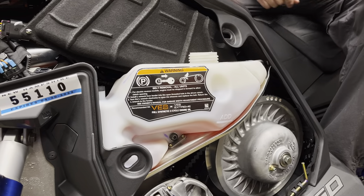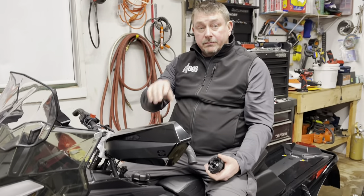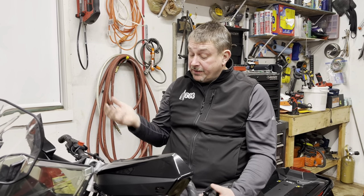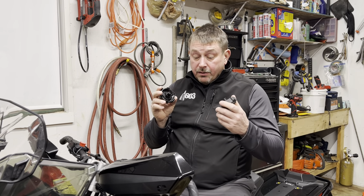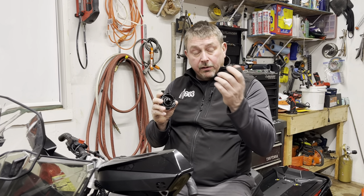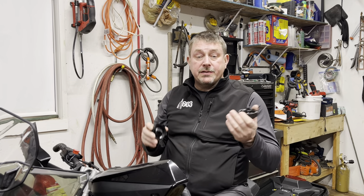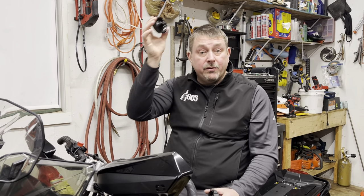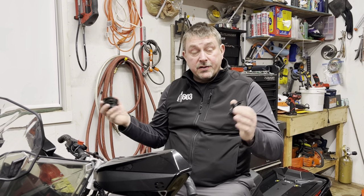It worked fine — as you can see I did 80 miles today and I've used a normal amount of oil for break-in mode, whereas yesterday I had used very little. Now, I know Polaris says don't pre-mix the first tank, and I never used to do this, but this year I decided to do it and I took it really easy on the motor as I broke it in. Check with your dealer and alert them to this issue. Also check your own sleds when you get them. Fellow ambassadors from the US and Canada, make sure you're relaying this information to your dealers and friends so we can catch this before it becomes a bigger issue — we just don't want these things burning down, especially with the COVID-related parts shortages around the world.